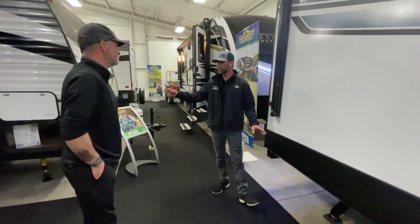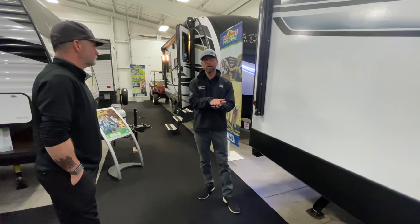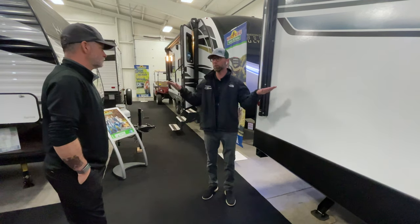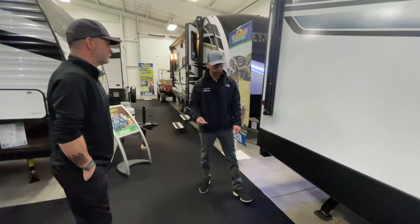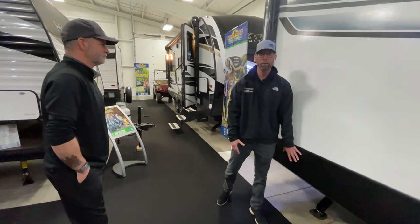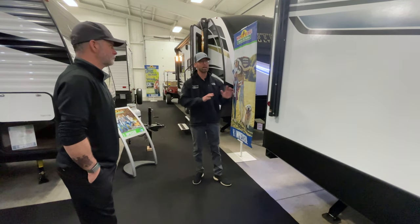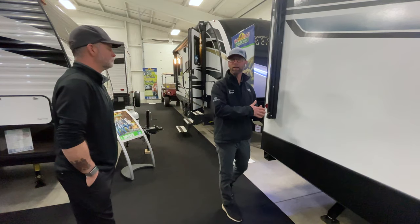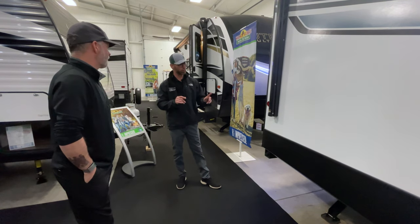These are stabilizers, not levelers — you really have to stress that. I've seen people throw their level in the camper and push the button trying to level it up — big no-no. When you get onto your campsite spot, find the most level spot when you pull up. If it means dropping a couple boards underneath the tires to get it level, do that first, then drop the jacks down to stabilize. I've seen customers try to use stabilizer jacks to lift the RV to slide that last piece of wood under a tire — it totally wrecks the jacks and causes damage under the frame.